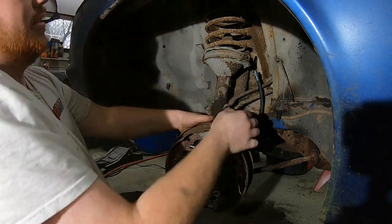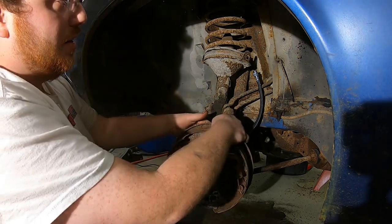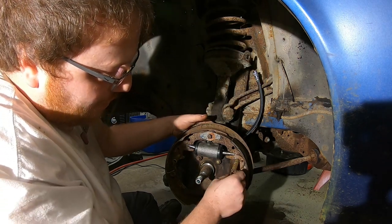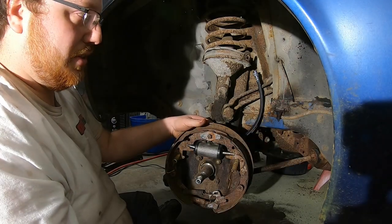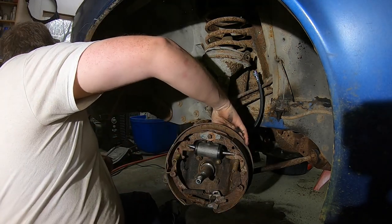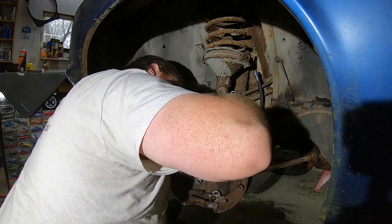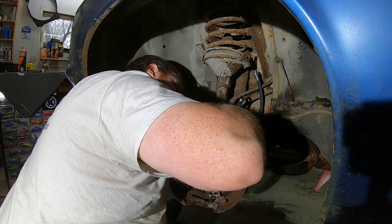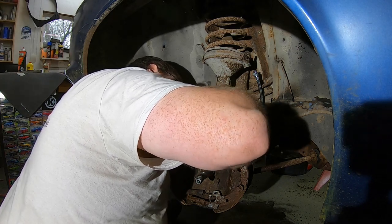So Rob got the fitting all cleaned up, looking 1969 factory fresh. Next, this has a few pits. Few. So once I get everything hooked up on here, once we start throwing stuff around, we are probably going to take a wire brush on a drill, clean up the line from here down, and have a nice clean surface to slide the fitting on. And then I'll flare that. I'm assuming it's just a standard flare. And then we'll move on to the passenger side. Gravity bleed, because it should gravity bleed easily with this, and then we'll probably just pump her up 2-3 times to verify that there is no air left in it. Bolt the drums and hubs back on and go out and do some hellacious burnouts, maybe.